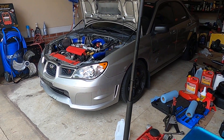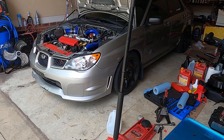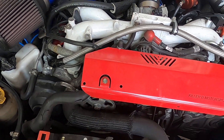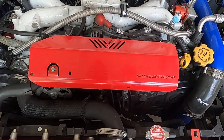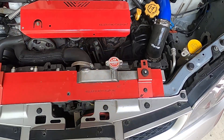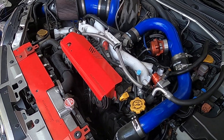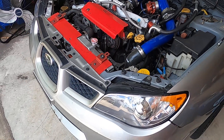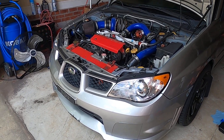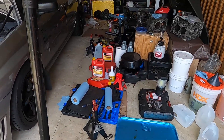There was a little coolant left because I didn't start the motor and get all the fluids running to flush everything out. I also have the adapter to go in there for future coolant temp sensor installs. I also think I'm going to have to replace the lower radiator hose — it's silicone, but when I took off the worm clamp, the teeth had dug into the silicone and bent it out of shape. To avoid any future holes in that silicone, I'll probably get a new one. Brakes are working fine.